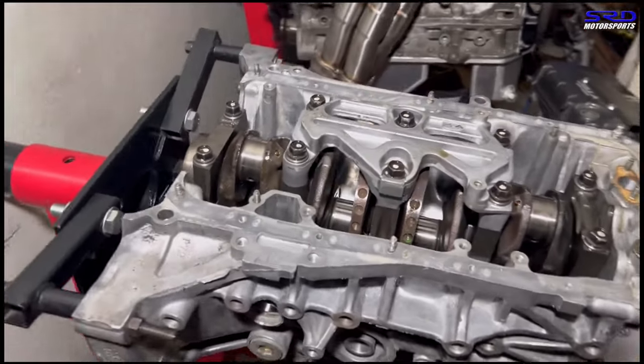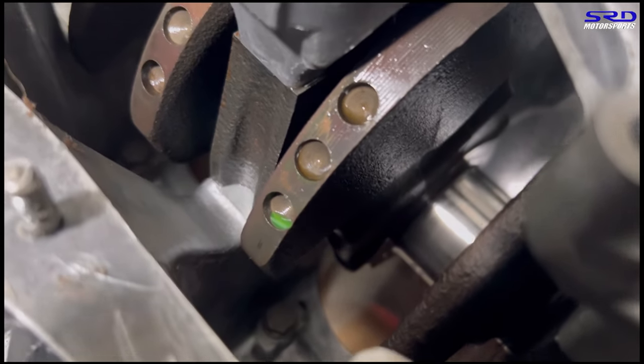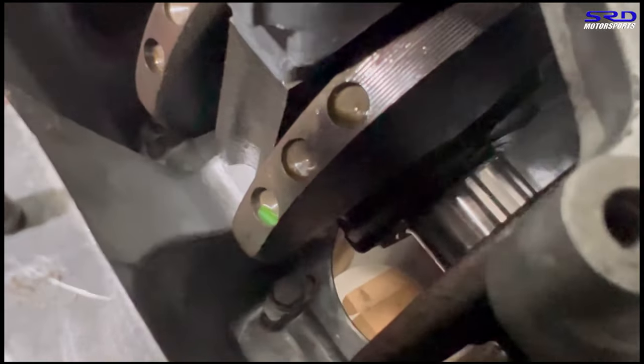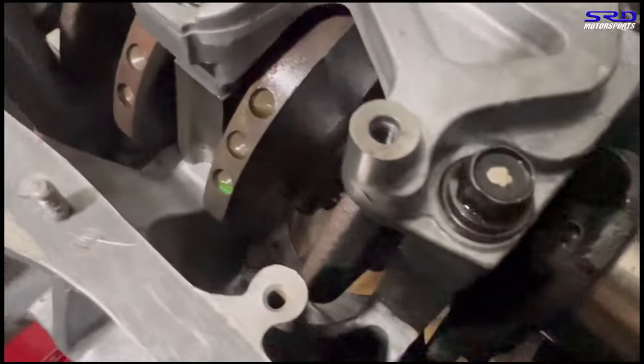Okay, let me show you. Where's the oil? There, you can see the oil jet. Wait, let's focus. Oh, sorry, there, it's focused. As you can see, the tips are off. That means the counterweight hit it and it snapped it off. And so maybe that's why the owner decided to buy a new set of ACL main bearings for us to check this and everything, all right?